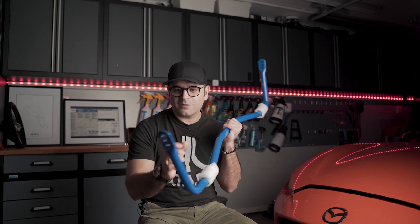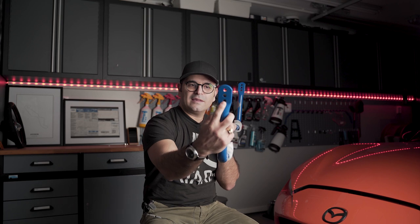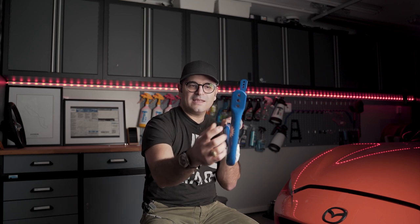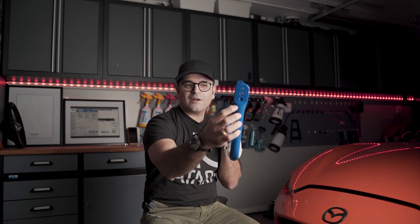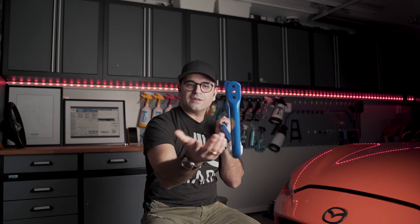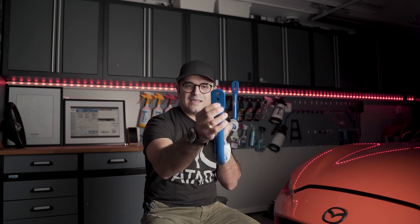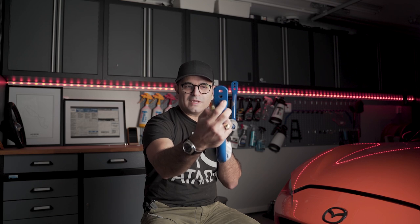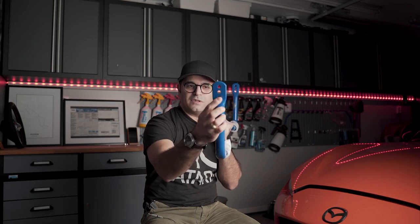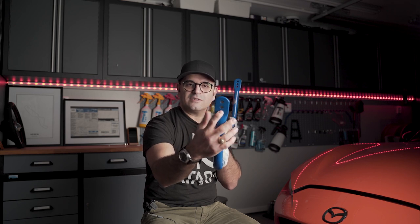not, because I don't know if you can see this. This sway bar has a three-way adjustment, and the hole which makes the stiffest setting is very, very close to the tubing itself, and I have read on the Miata forum that a person had difficulties, or it was not even possible to use this stiffest setting because the bolt and the washer actually come in contact with the tubing here, which renders the stiffest setting useless.